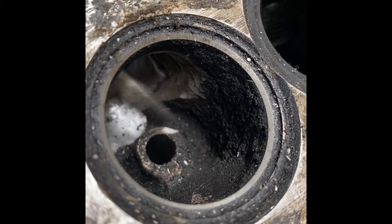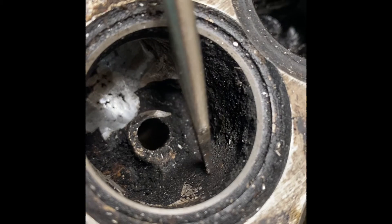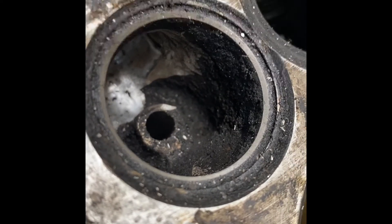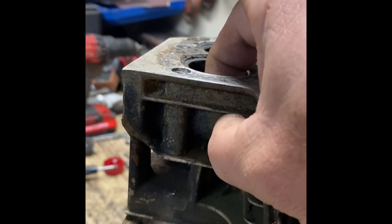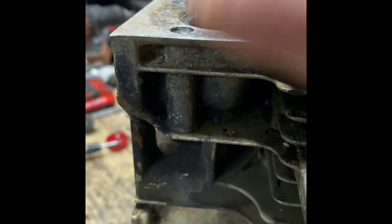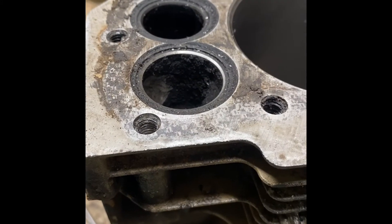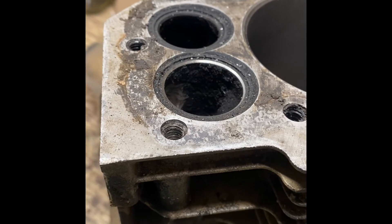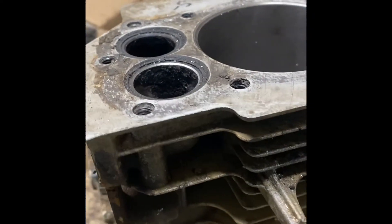Remember with that 90-degree intake manifold on there, the fuel didn't even go down here, but the air does. We're also going to take this little step out right here. Depending on what engine you have, be damn careful doing this — you can't just go in there and hog because that is your actual port wall. Take a measuring device, or even just use your fingers to feel, and make sure you don't take material out where it's already thin. We're working with basically industrial 3500 RPM lawnmower engines here — there are certain things we're just not going to be able to do. Don't break through the wall of that port and don't leave it paper thin. I would rather leave it a little bit thick and sacrifice half a horsepower than make it paper thin where heating and cooling cycles crack it and you throw the block in the garbage can.